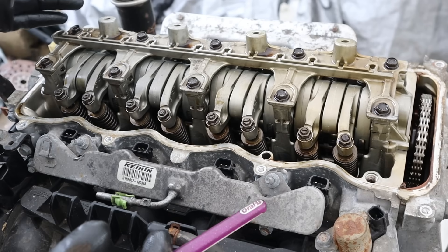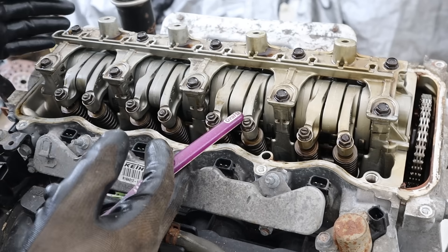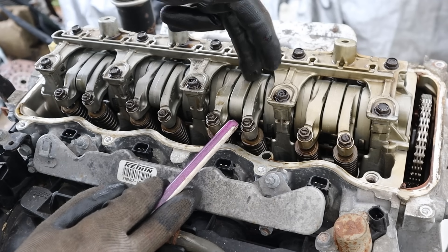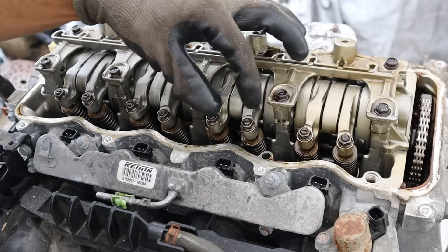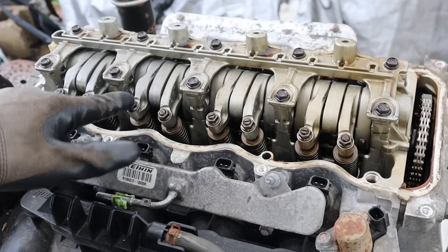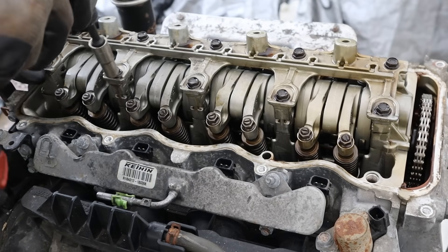This was the 2000s where people got scared out of their SUVs due to the fuel crisis and went back to economy cars like this. As a result Honda didn't put real VTEC in — they've got economy VTEC or iVTEC in here. Essentially you've got a rocker arm system with a shaft that runs along the center, pressing down on a camshaft below which is powered by a timing chain. Those rockers correlate to these valves to open them at different heights. You also need to do manual valve adjustments once in a while, otherwise the top of this engine is going to be clucking around like a chicken. Let's pull off this rocker arm system.